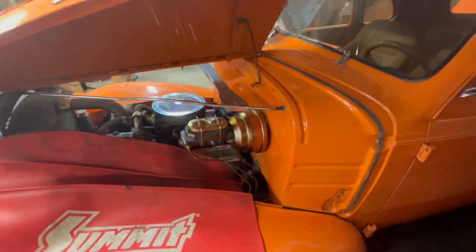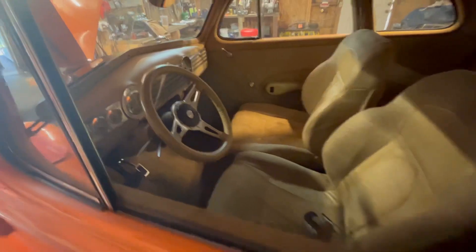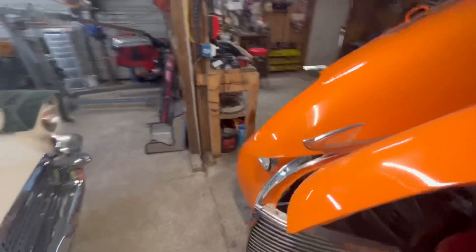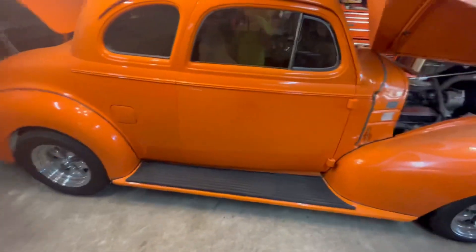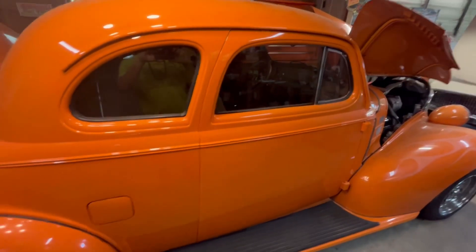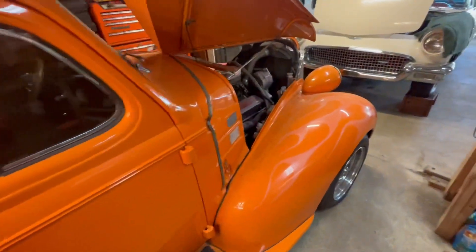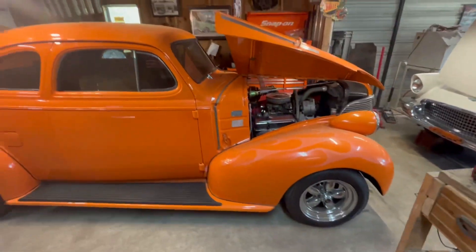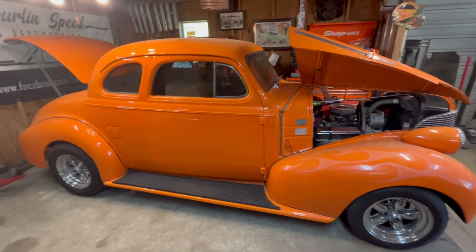Got the timing set on the engine for them. The fuel gauge was not working — had some rat damage — so we rewired the fuel gauge and cleaned up the big mess of wiring in the trunk. We added a couple of relays and have some distribution blocks coming in to really clean that up and make it look nice. The door popper was not functioning; I put up a short on that, modified the latch assembly and got it to where it'll kick out and work right. This one should be going home next week — we'll get it finished up, cleaned up, and back ready for car show season.